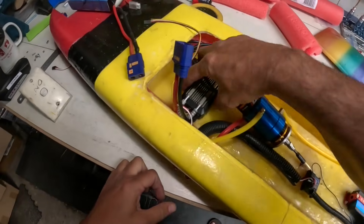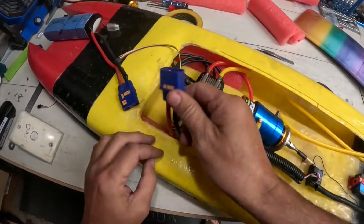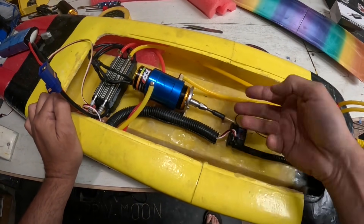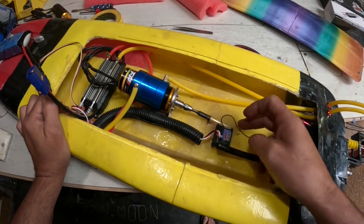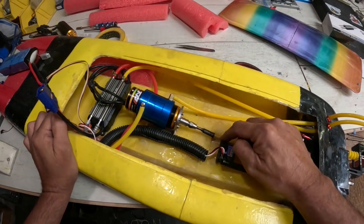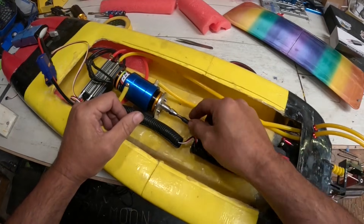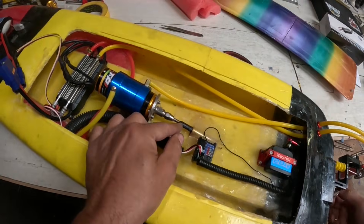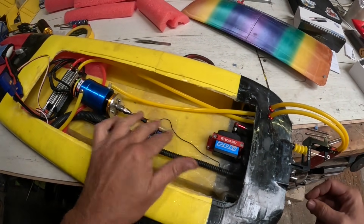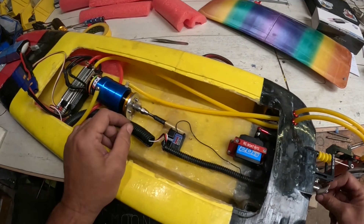Speed controller is bolted in. I put a QS8 connector on there because I intend to run this speed controller on 12S later on, so I don't want to destroy the terminals with sparks. Something I just came up with — Brock and I have been talking about for ages about how to stop grease coming up the cable when you don't run a liner and just fill it with heaps of grease. In the end I just had a go at putting some 7mm heat shrink on there. It's not going anywhere, nice and tight but not too tight on the cable, so the grease is hopefully not going to come back up. I really packed it with grease — there was grease everywhere after yesterday.